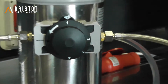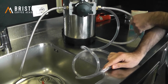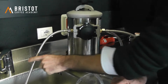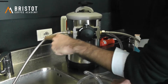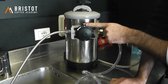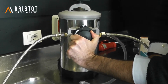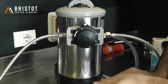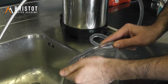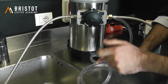Now we're going to see the steps. First, we need to make sure we have the outlet — the bypass — so the coffee machine inlet will be down this way, and the outlet where the arrow is means this is actually the exit from which the filtered water gets into the coffee machine. From number one, turn it anti-clockwise until number two. Hold it still, otherwise the water will go anywhere — usually it's already fixed in the drain system. Go to number two until you hit the click.